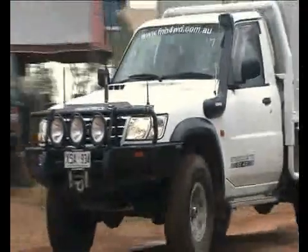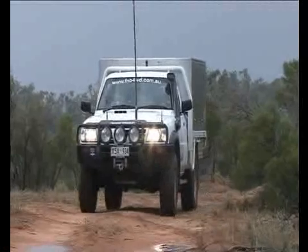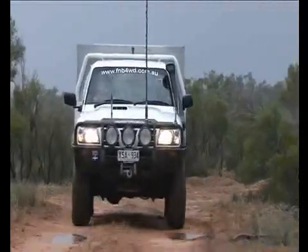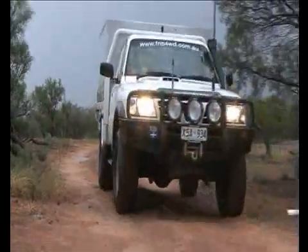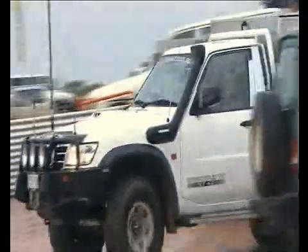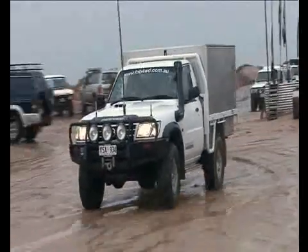Scott from Berrimadiesel will be the man to answer this one. A popular modification on a lot of the Nissan Patrols is to put a thermofan on top of the intercooler to get some airflow over it. Often they don't get much airflow — depending on driving lights and things up front, a lot of air can toss up over the top of the bonnet scoop, so you're not getting air in to cool the intercooler down. The thermofan on top can drive air over the intercooler and actually help improve performance quite a bit.